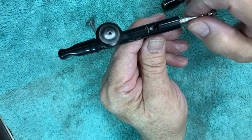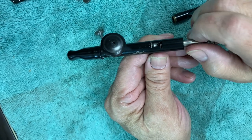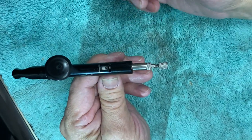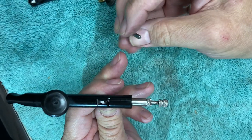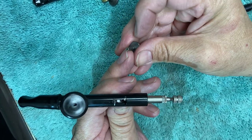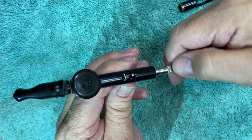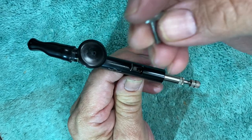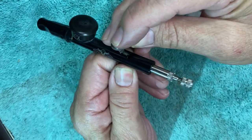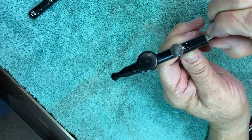At this point I'll bring this part forward because we're going to help lock that piece in, but we still have to maintain the spring actuator. Back it up slightly — we don't want it all the way tightened down yet. Take the trigger — you can reverse it either way, it's what captures the pin. Now take that indent and drop it on that nipple. Push this in and it shouldn't take much pressure. Grab it at 90 degrees, drop it straight in, and find that nipple. You'll know you're on it because this is now pushing for air — then let it rest forward and finish tightening.